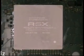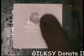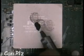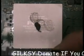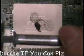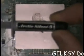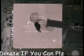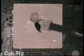Alright, same with this. You can reuse your finger which has still got some on. We want to put a blob in the middle. Just so you can gauge how much I'm using here — one of these 3.5 gram tubes will actually do in the region of about 10 PlayStations. So that's a good gauge on how much I'm actually putting on the chips. It's hardly any.